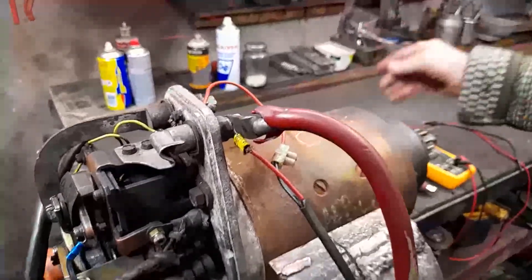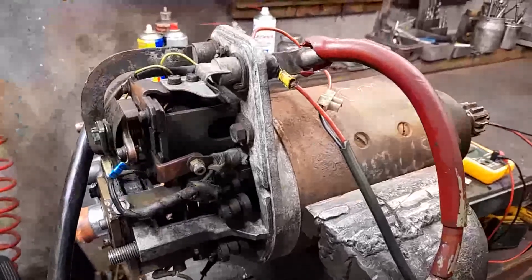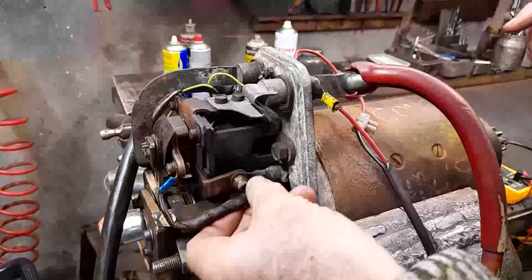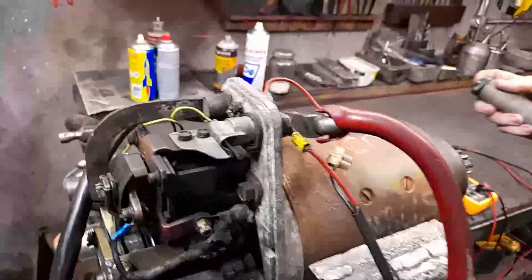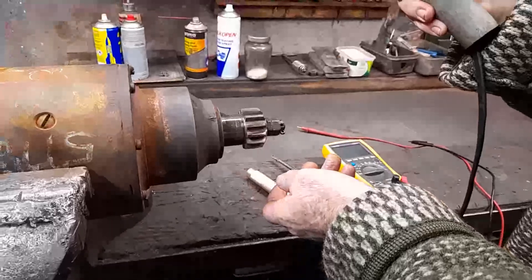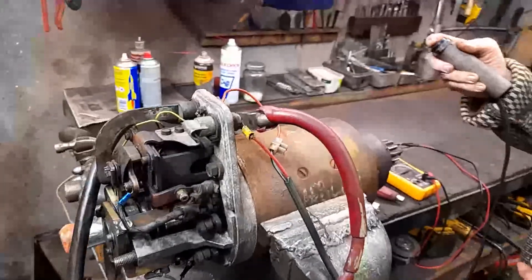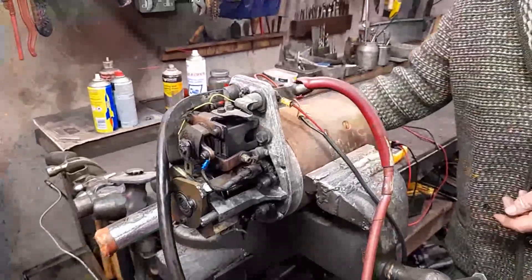But in this case, it's not doing that. It's supplying sufficient current through this thin wire here into the auxiliaries, which is sufficient to move the rotor out, but insufficient to turn the pinion with any energy. There's not enough energy there to stir your tea, never mind start a big diesel engine. So what's wrong?